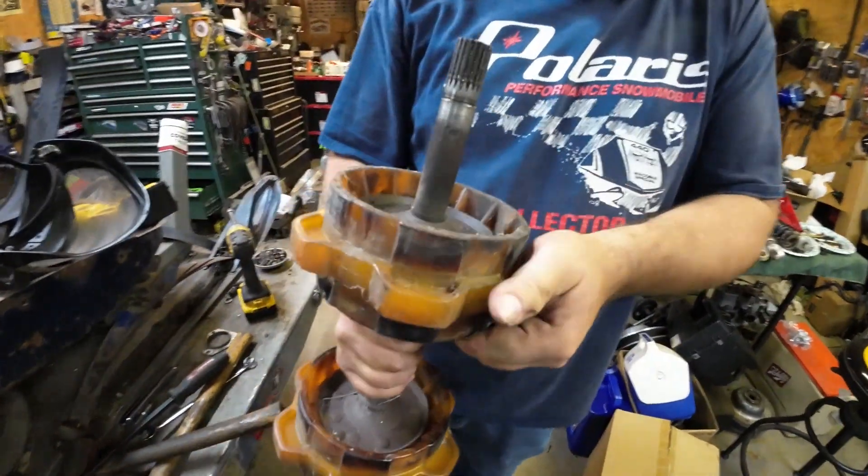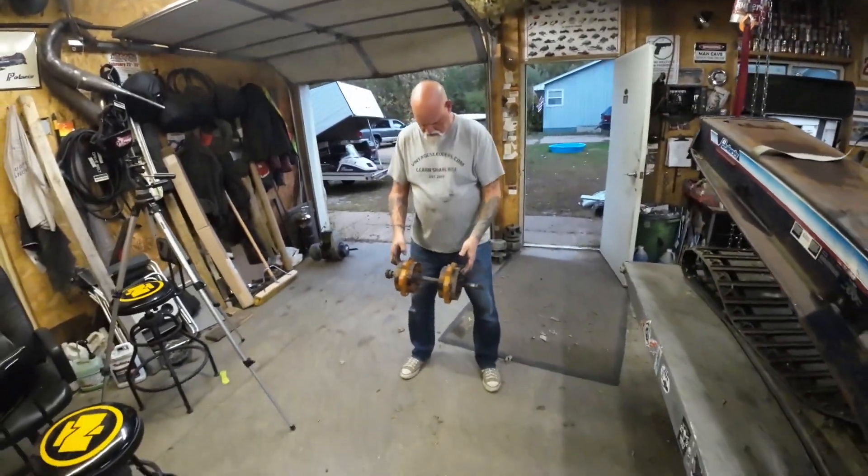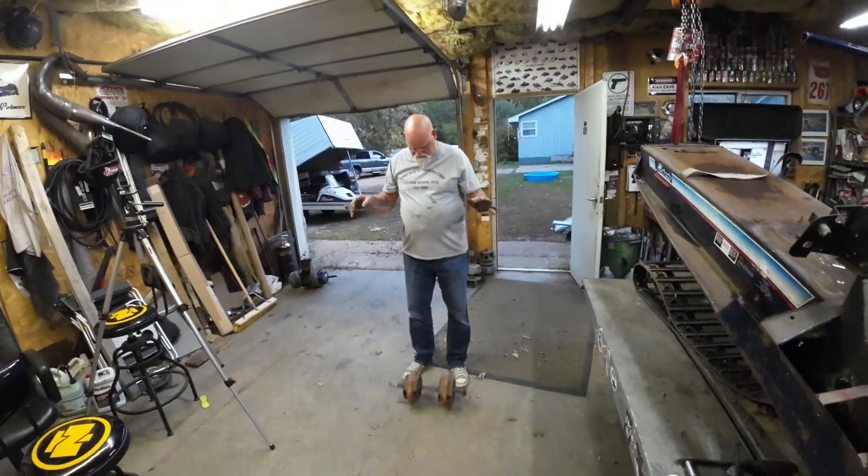Let's take a look at those. Drop her square, don't damage the splines. Those are good drivers - she bounces really good. If you have an older Colt - a Gemini and a Colt are the same, like a '72 or '73 Colt - and your drivers have never been replaced, they aren't gonna bounce like that, they're gonna shatter into a hundred pieces. These are really good drivers. If your drivers break from that test, they were gonna break on the trail - better to find out right now.